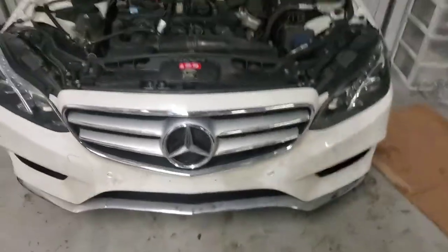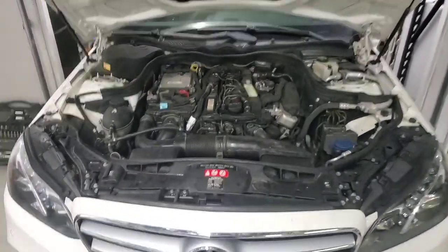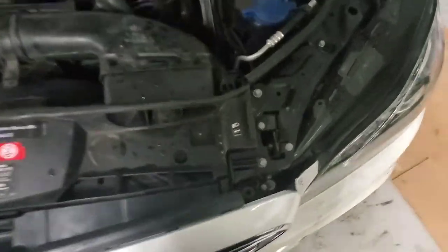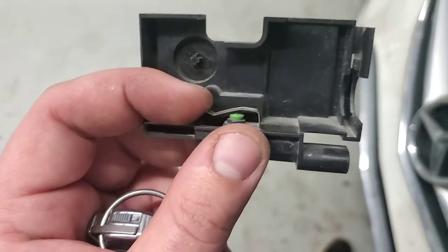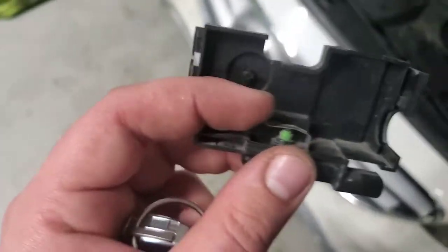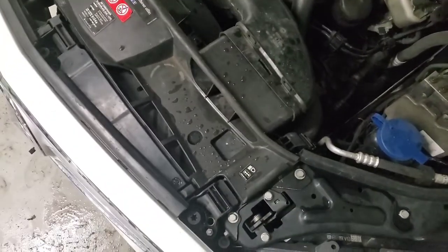A little thing for the thumbnail — hood latch. There's a little ding ding ding that interrupts your music when the hood is open. On a Mercedes there are two hood latches, one right there, one right there. Each hood latch inside has a switch like this. This is on a 2016 E-Class E250.